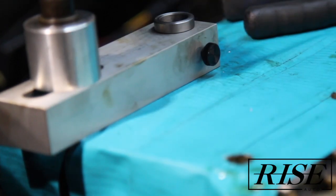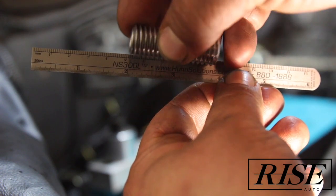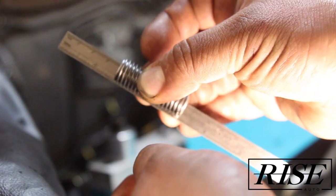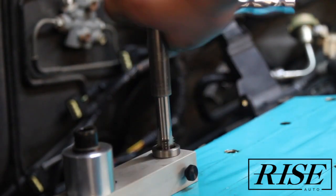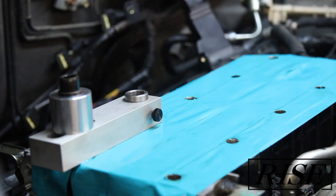Now we're going to tap this. The kit says it's going to have to be an inch and a half deep. Here's the tap — let's put it at the inch-and-a-half mark, which puts us roughly at three and a quarter. Put a little bit of cutting oil on. We're going to use an 11-millimeter 12-point socket for this. Blow out your tap and blow out that hole.